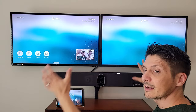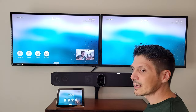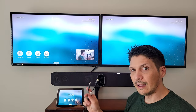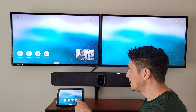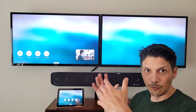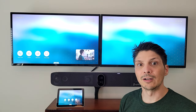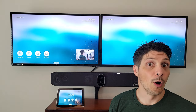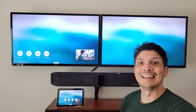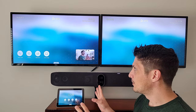The default experience is Poly mode — you can choose from Zoom Rooms, RingCentral, and a few others so that platform becomes the experience on screen. We also have the extra HDMI and USB cable here so we can use device mode. Device mode lets us plug in a laptop, take over the room peripherals, and bypass the OS so we can effectively use the camera, mic, speaker, and display on our laptop — useful for meetings on platforms not yet supported natively, like Microsoft Teams.